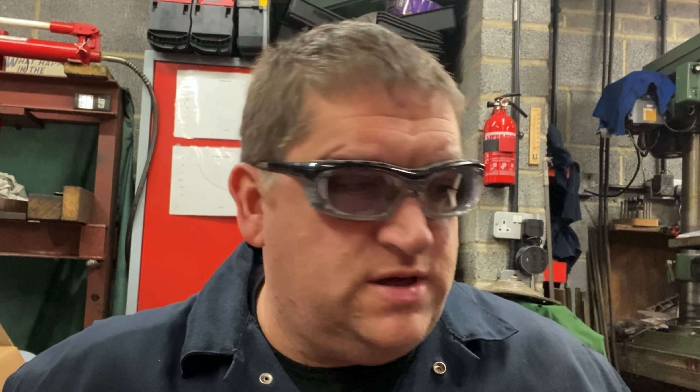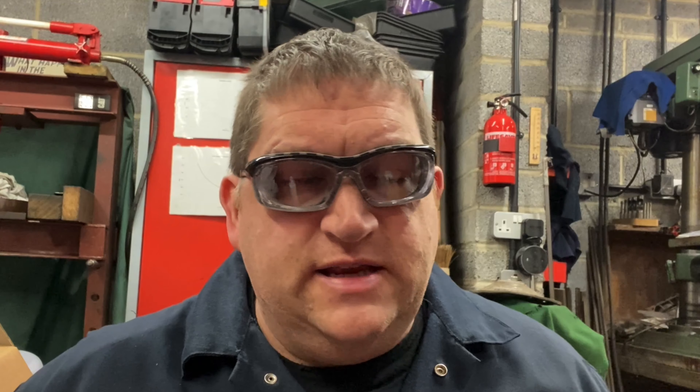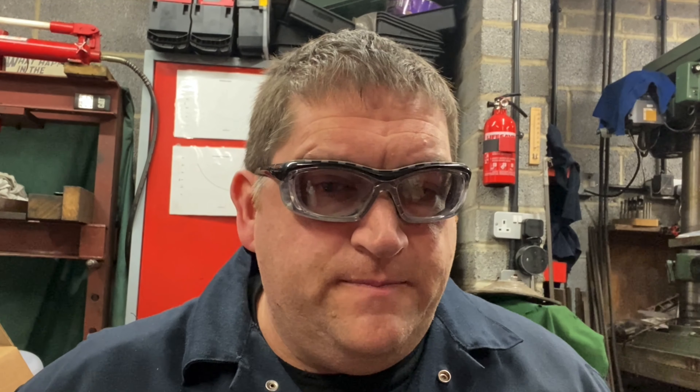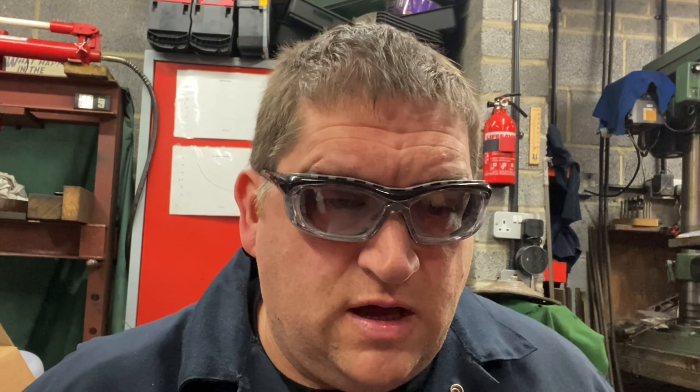Sonic testing greatly enhanced the success of my boring. Some blocks typically have thicker cylinder walls than others due to production tolerances. You'll also notice that cylinder walls on a Series engine tend to get thinner as you go up from the bottom of the block towards the top - two thirds to three quarters of the way up you normally find the thinnest section, which is right where you don't want it because that's where cylinder pressure is highest. It's very important to maximize your bore wall thickness to get a reliable bore.